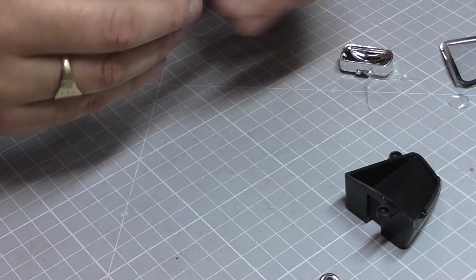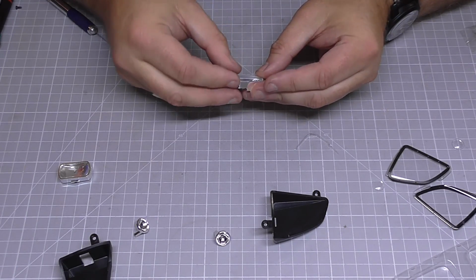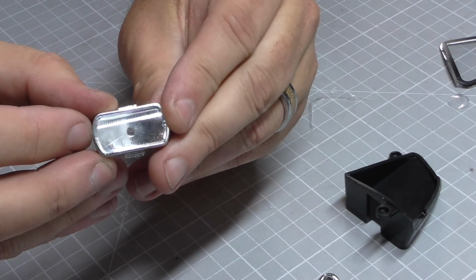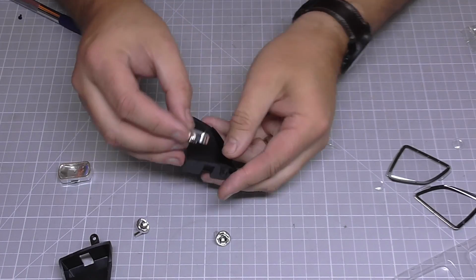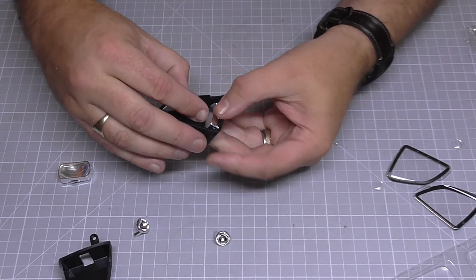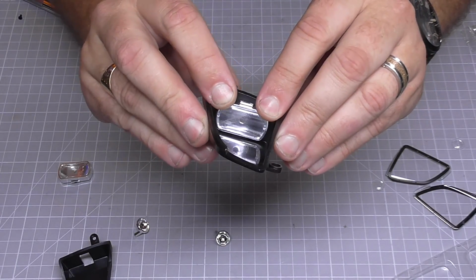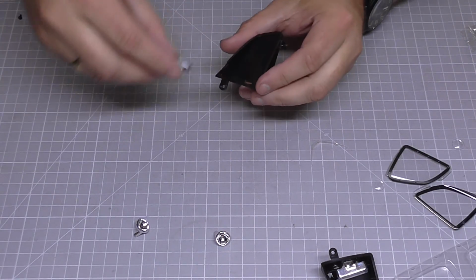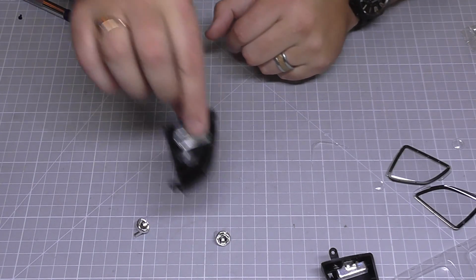Do the same on the other side. Line up the notch. And then that's in perfectly. It will hold its own. Now these are all labelled, so make sure you take the right lens, which is this one. This is labelled R as well, and that's just going to go behind here like that. Again, so the design is facing upwards. And that's kind of how it's going to look in the housing. Just gently put that down because that's where that's going. Do the same with the other side. Again, make sure we put that in the right way. And I'll just keep that to one side.